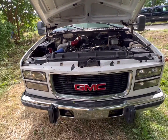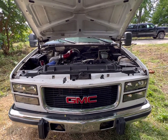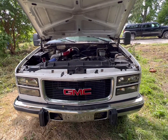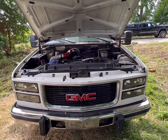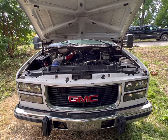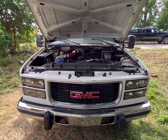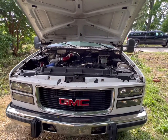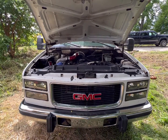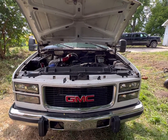The Super 54 HX35 with the intercooler, I was peaking around 17 pounds of boost. My air intake temps during summertime — call it 75, 80 degrees outside — were still getting around 280 to 286 degrees; I peaked at 286 racing at UCC. So it was still pretty hot. My drive pressure was, if I was making 17 pounds of boost, I was seeing around 21 pounds of drive pressure — she was working a little harder. The intake temps were lower, but they weren't as low as I wanted them to be.